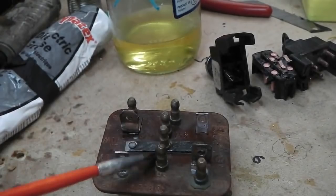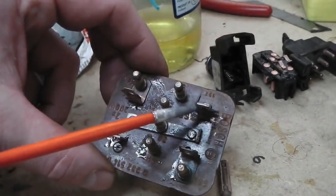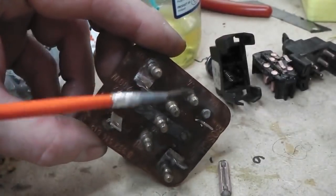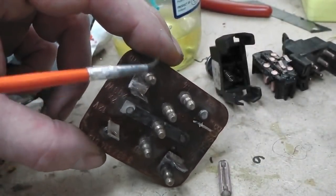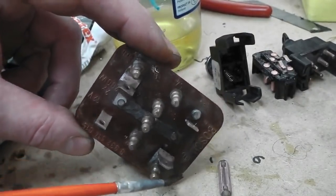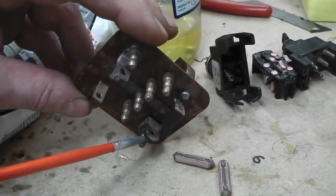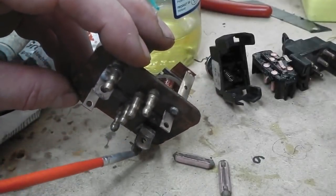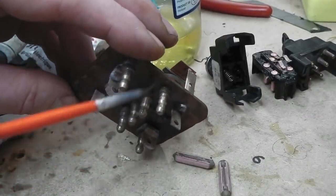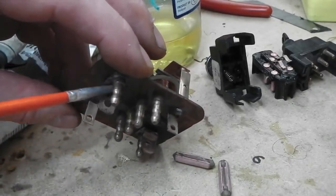A little bit of our acid friend again, and we will blast this one. These fuse holders here, renowned for going, and so are these connectors here. Probably one of the most common headlamp faults on the Cortina. Bad connections on these pins. So these are a real candidate for your contact grease. You can use another one called Connector Protector. It's an American one again. That's pretty good. I've used that in the swampy days.